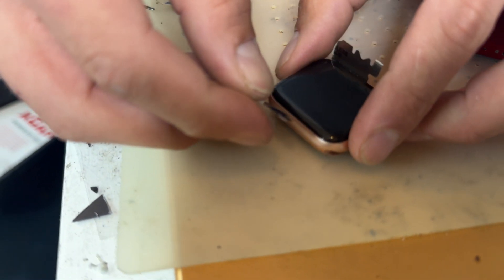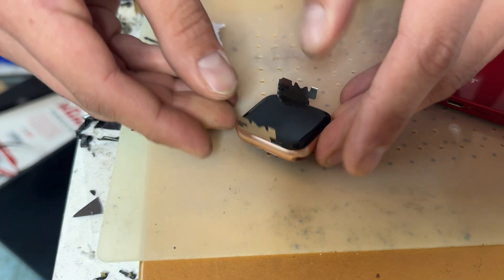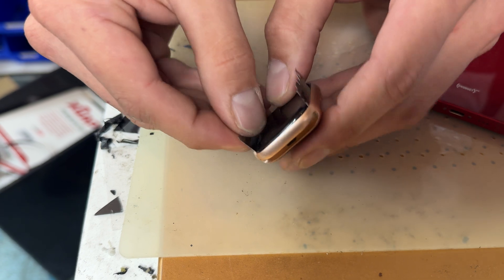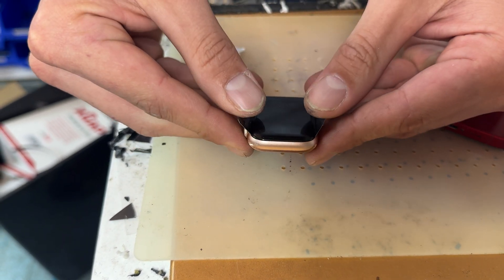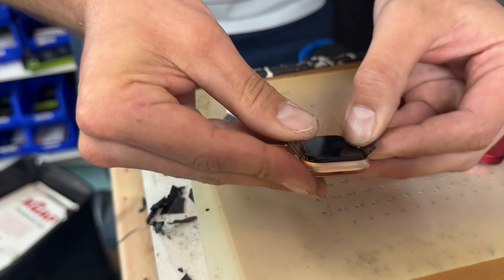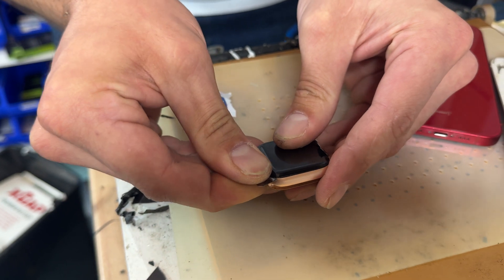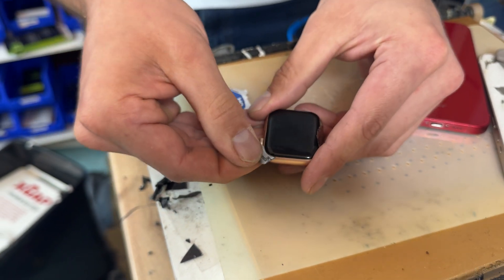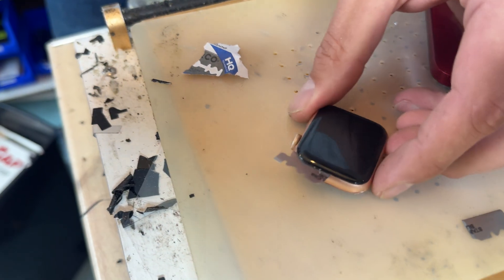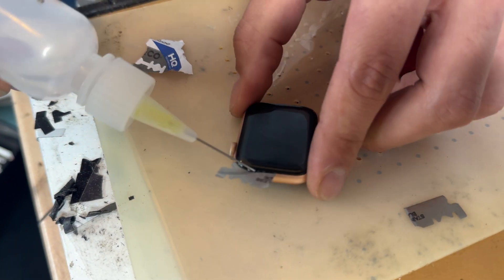It's really awkward — I've got big hands and they're getting in the way. Make sure that the blade is flat in there on both sides, and then all we're going to do is pry it to pop it out. Just pry like that, slide it underneath, and once you're underneath you've created your gap.